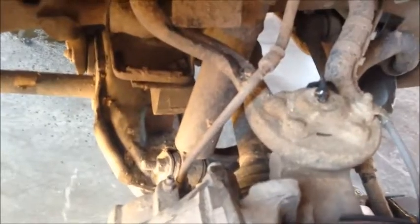If you have the dust covers here, that's what my screwdriver is for. A lot of times they're hard to pull out. Once you loosen them, it's like they're all the way out, but they won't come out. I pop these dust covers off. I like to take them off anyway, and I'll explain why in just a second. So I pop the dust cover off. There's my bolt. Once I loosen this, it only wants to come out so far, and sometimes they get hot and they just don't want to come anymore. So then I use my screwdriver right on the edge of it after I believe I've got it threaded all the way out, and I tap it out. If you need to do that, go ahead and do that.